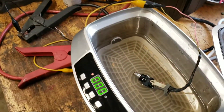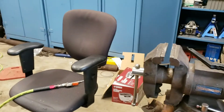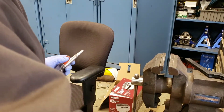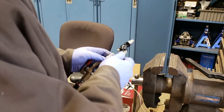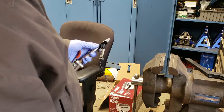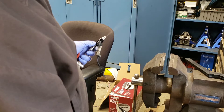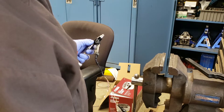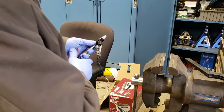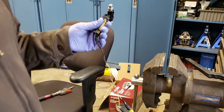After the first pass through the ultrasonic cleaner, I want to show you how I was checking the pattern on these — just in basic air. I have it down to about 20 psi. I used the contraption I was showing you earlier to open the injector and then spray. That's quite a bit of fuel — so it looks good. You can hear it clicking. That's the first pass on this injector; we'll do two more.